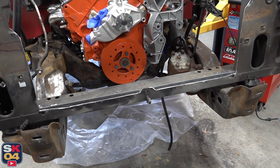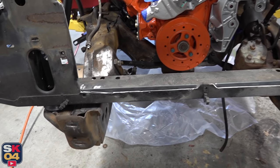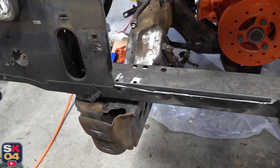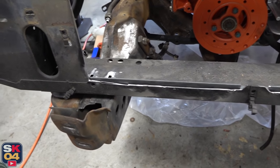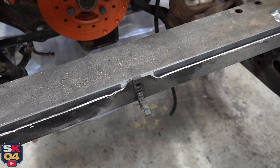The bottom piece fit just fine after a couple of modifications. I had to get rid of the little tabs on either side that originally held the rubber isolators. I also made a notch in the middle to account for that metal clip — that's where the bottom of the hood latch support bolts into.